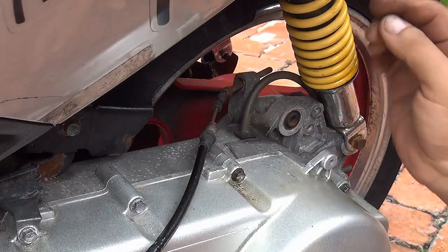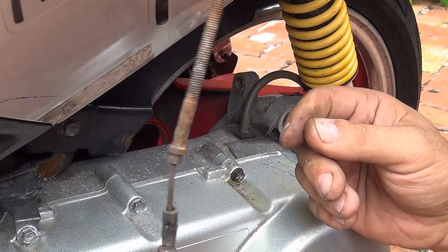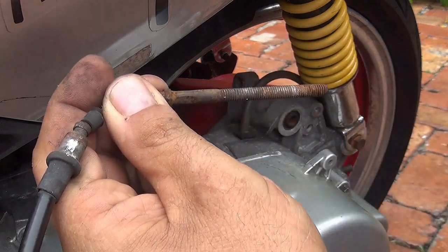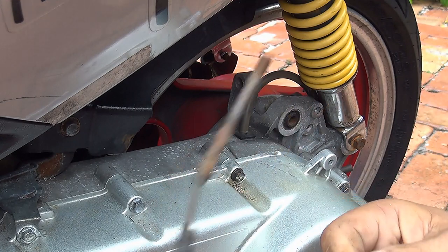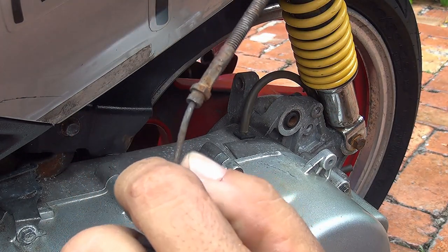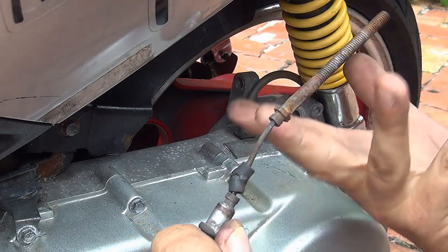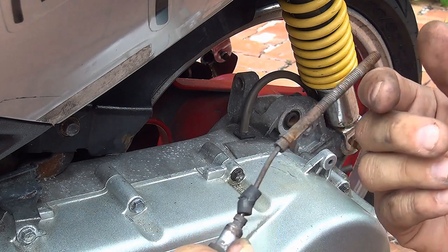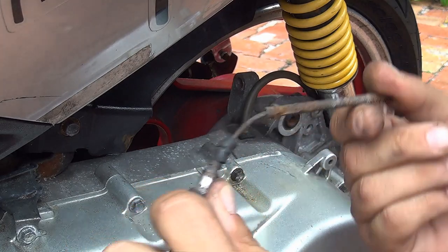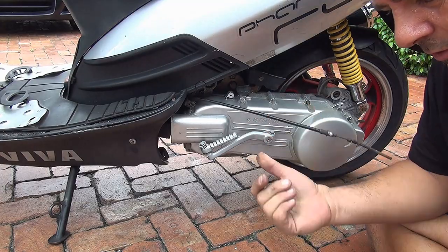Pull this part away — here you have the long connection of the brake cable, the screw part where you get your tension and pull the cable. This is the rear side. Many times these cables look pretty good inside but after a long time they get rusty and need to be changed before they break on you. If they break when you're trying to brake in a dangerous area and need immediate braking, you're going to have a problem. Make sure these cables always look perfect.